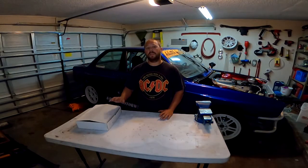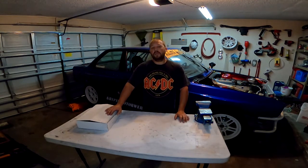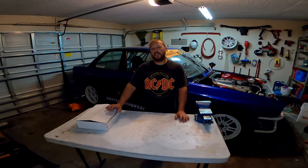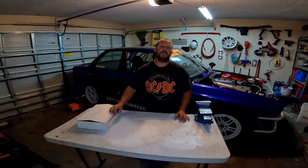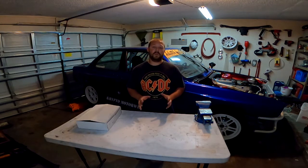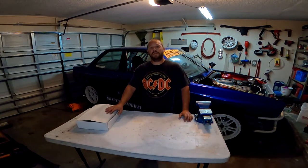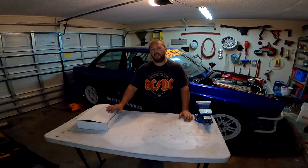The only big thing we have left is to install the ECU, which is what we're going to be doing in this video. Now the ECU I'm going to be running is a VEMS unit. It is a true plug and play for an M52 engine and allows you to stay OBD2 as well, which is what I really wanted. You do have the option if you want to run a big name ECU like a Link or a Haltech or ECU Masters, you can convert to OBD1 and run it that way, but I really wanted to just use what I have. I'm trying to make this as simple and reliable as possible, and these VEMS units have a lot of support these days and people seem to be having really good luck with them, so we're going to be using it as well.